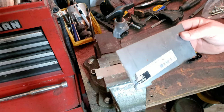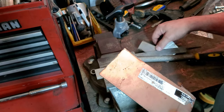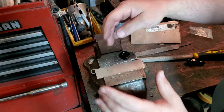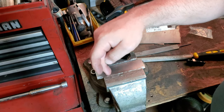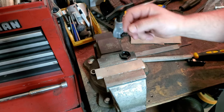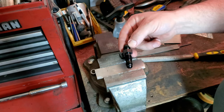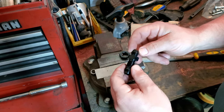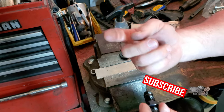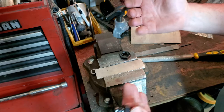So I just got a piece of blank 16 gauge I'm using here. I've cut all kinds of different stuff out of this and used it for different things. Cut this little piece here. What I end up doing is folding this portion here that will hold up against the body on Goose Run. Use a rib nut to hold this in place. But my idea is to install a bulkhead fitting, a dash 6 AN bulkhead fitting, so that this can hold the line on the return side.